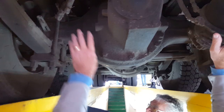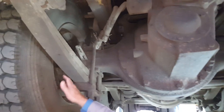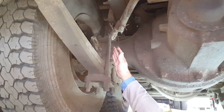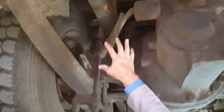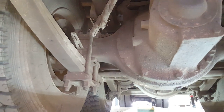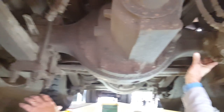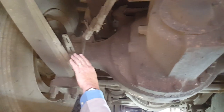We're missing a complete booster configuration here — no brake shoe, no S-cam, no slack adjuster, no brake booster. The booster has been totally taken off and there's nothing in the drum — no assembly from the slack adjuster all the way through into the drum.